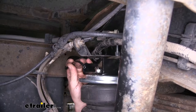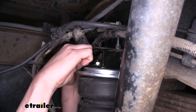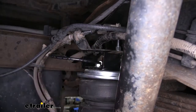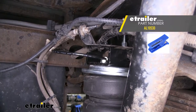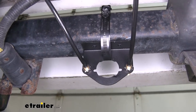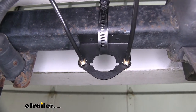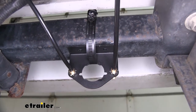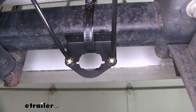Now, depending on your van and what you're using it for, the length can vary, and you may need more hose to complete your installation. After you cut your airline hose, slide it into the quick connect fitting on the airbag — it just pushes in. Go in and out to make sure you're fully seated. Then wrap the hose back towards where you're going to mount your airline fill connections. When cutting your airline hose, make sure you use the proper cutting tool — you can pick up hose cutters at eTrailer.com. These ensure a clean, square cut for a proper seal inside the quick connect fittings. Route your hose towards the rear of the vehicle following the frame and the factory wiring, zip tying it along the way. Avoid anything that moves such as steering and suspension components, or anything excessively hot such as your exhaust. We mounted ours on an existing bracket at the back of the vehicle, drilling out a couple of holes using a 5/16th drill bit, then securing it with a nut, star washer, flat washer, rubber washer, and nut.